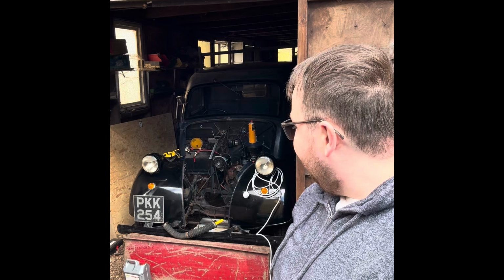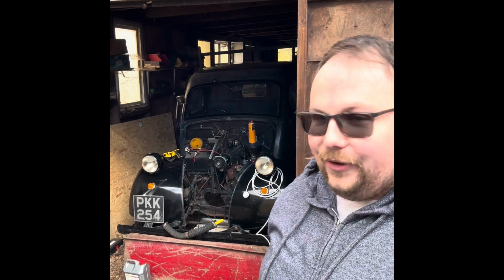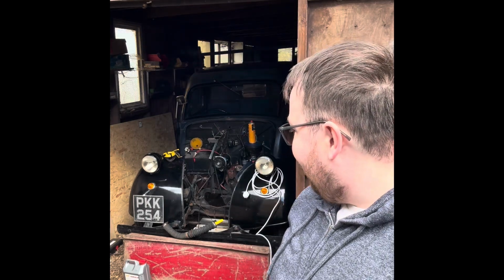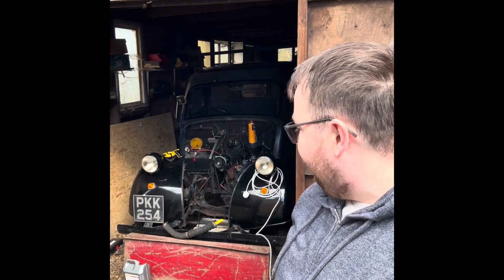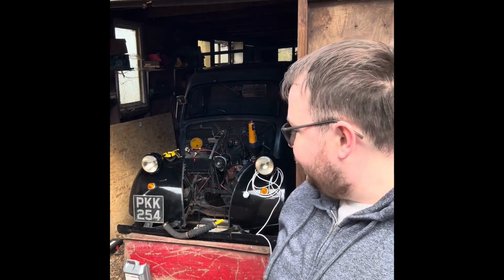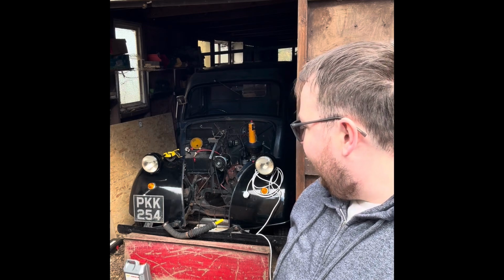So obviously in the two and a half years that it's been laid up, we've got some problems with our cooling system now. Bad quality antifreeze, it seems, has played a big part in creating chunks of rust inside the block, which then clogged the radiator.